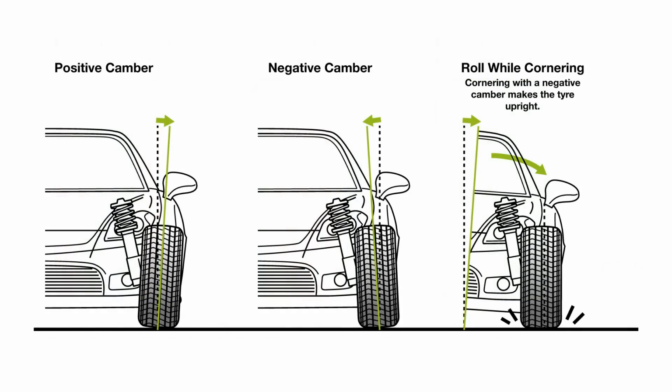One more thing to keep in mind with camber is that you'll want to go lower on the driven wheels compared to the non-driven ones. This is because the tire begins to roll back towards its natural position as you start to exit a corner, and if you have too much camber, you won't have the maximum contact patch possible for putting down power. We'll go over some examples of that with different drivetrain configurations in a little bit.